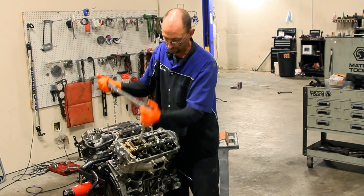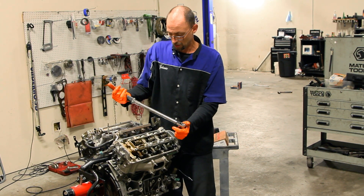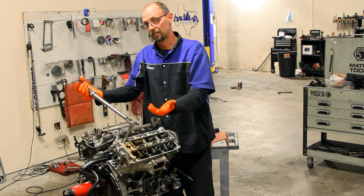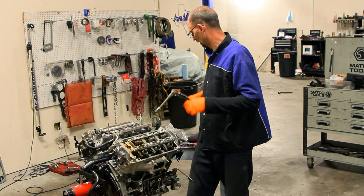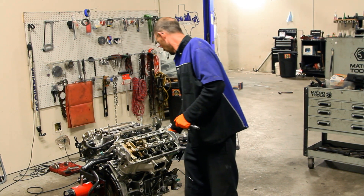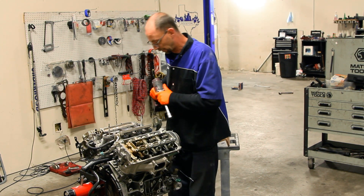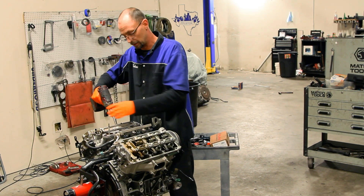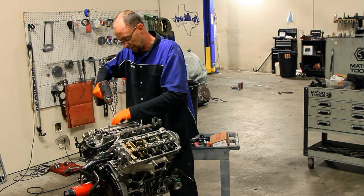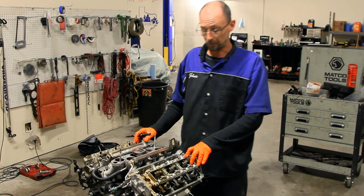The way I typically do this, if I'm doing both sides, I like to get everything set up before I start the torque angle part — that way I can just start with one and continue until they're all done. We are back: all of the heads are preliminarily torqued at 22 foot-pounds.